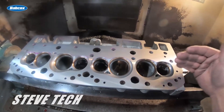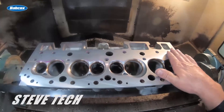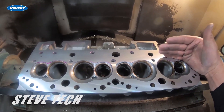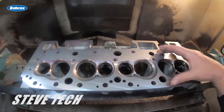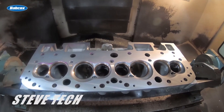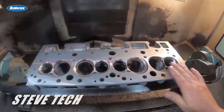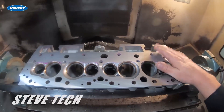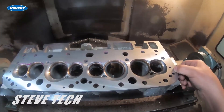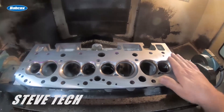There's no exact number for that — you need to figure that out. We try to leave as much deck material on a cylinder head as possible, because thicker deck material holds gaskets better. Since we're making big boost and big power on everything, we want as thick a deck surface as possible. We just want to keep good material up there, make sure it's thick, and make sure you have a very fine surface finish in that 10 Ra area, and make sure it's flat.